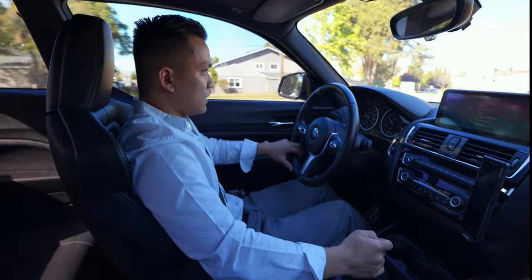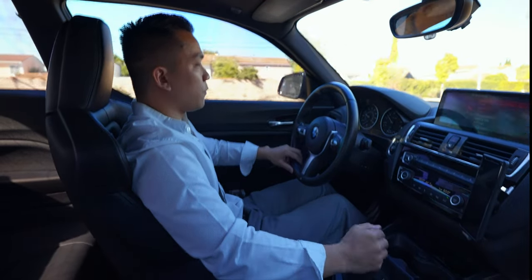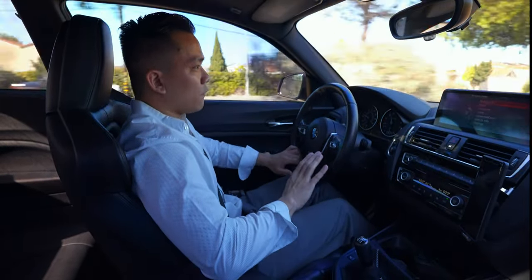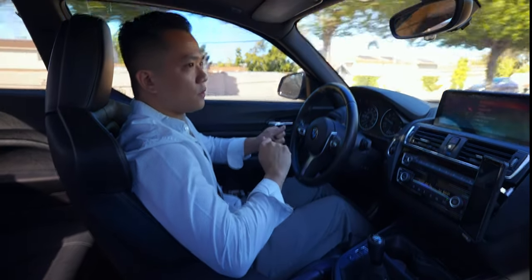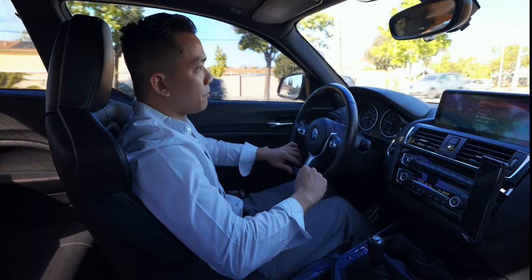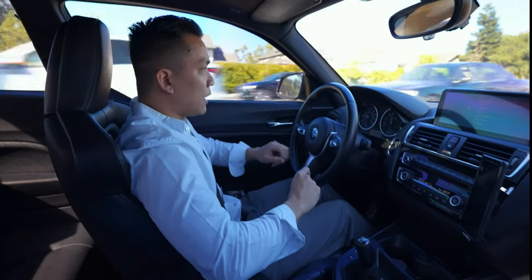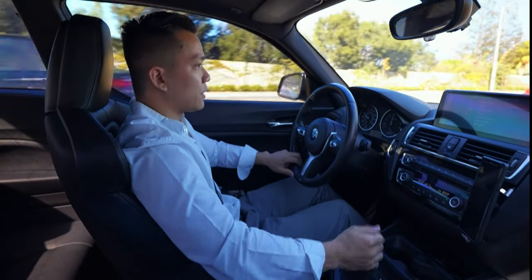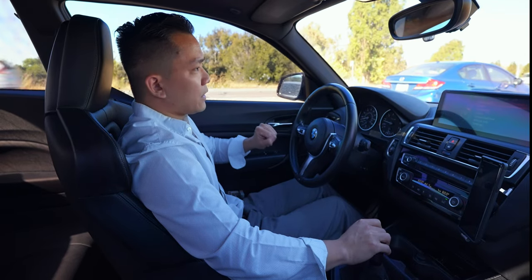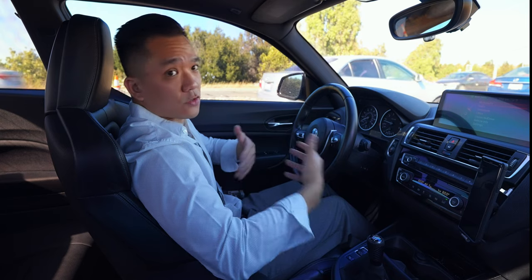The last issue is downshifting in general. Approaching this red light — I purposely went into fourth and let's see, downshifting to second — I had to hold it there for a split second longer than I really needed to, and you saw that bit of jerking. Essentially what happens when you're downshifting is not only are you going to a lower gear, but the resistance in the line seems to affect how fast we can let out the clutch. We're not getting enough pressure through the clutch line to allow the clutch to engage the new gear.